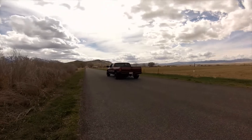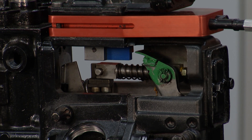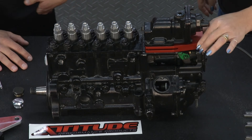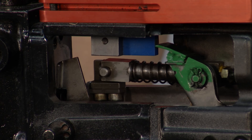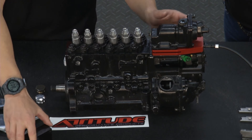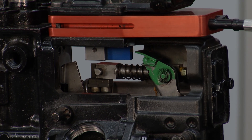When we're towing, we get concerned about EGTs. We're typically seeing about 100 to 200 degrees cooler with the mechanical P-Pump chip, and we're able to do all of this without a computer. This is the adjuster — the piece we're seeing in red — installing inside the truck. It's controlled by the cable-driven dial that runs inside the cab, which controls how much throttle we actually have. The adjuster sits on top of the pump, the AFC housing sits on top of that, with the cable running into the cab. Off of one rotation of the dial, we can get complete rack travel from zero cc's of fuel to whatever maximum fuel output the pump will put out.